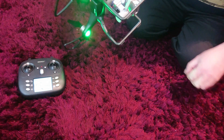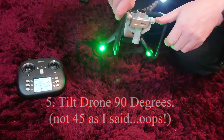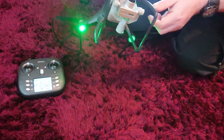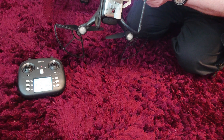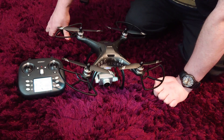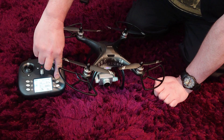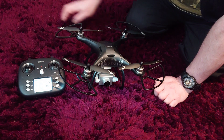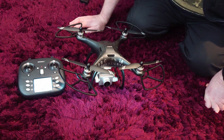When that happens, you next have to turn the drone 45 degrees and do the whole rotation thing again on that axis — probably not letting the drone touch the ground. Eventually you'll get flashing red and green lights, which means the gimbal is now calibrated. You can place the drone flat and try out the gimbal by pressing the up and down buttons — you'll see it moving down and up. The gimbal is now calibrated, which is as hard to say as it is to do.